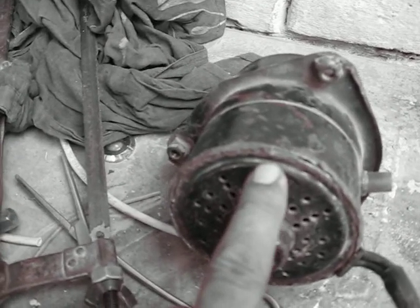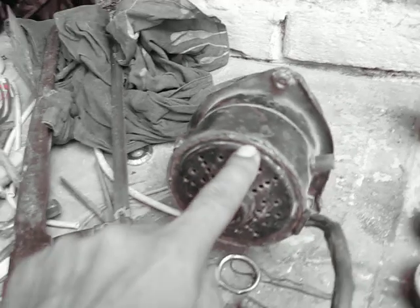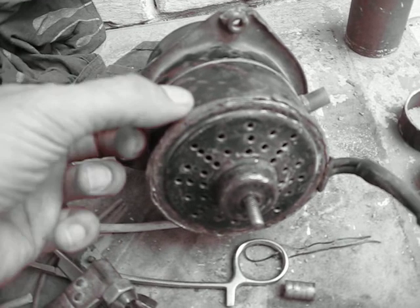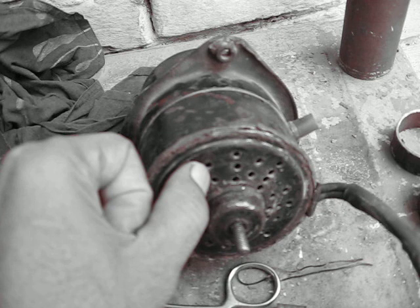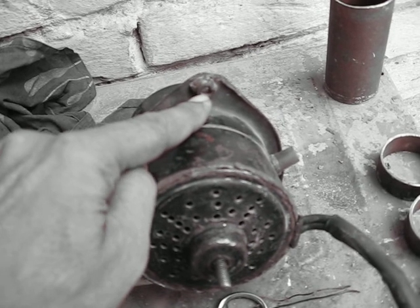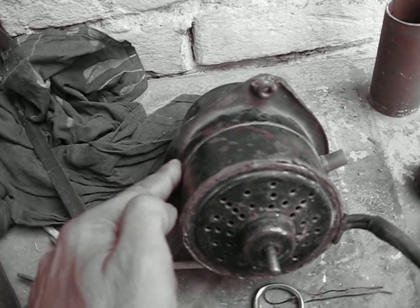You will see that the back plate is just — there is no way to unscrew the back plate. The back plate is actually this portion of the metal. It is coming inside and is being folded inside to hold the back plate, right? So what I'm intending to do is to make a collar right here, just like this one. This one holds the motor. I cannot use this one, so I'm intending to make a ring around this motor.